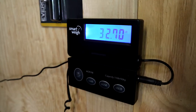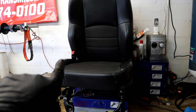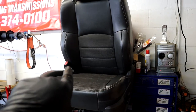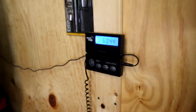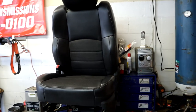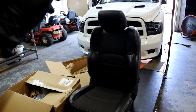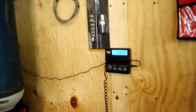Without the cover we weighed it and it was about 30 pounds for the entire setup, so with the cover you're at about 32 pounds. We have the factory driver's seat, which is a power seat, on the scale now — it's about 10 and a half pounds heavier than the passenger seat. On the scale we got 60.44 pounds — definitely heavier than the Kirkey combination. So going from the driver's seat to a Kirkey seat, you're going to drop 30 pounds. On the passenger side, which is not power, you drop about 20 pounds — the passenger seat weighed 50 pounds, driver's seat weighs 60 pounds.